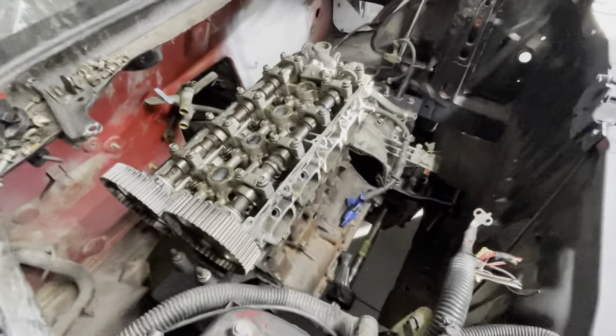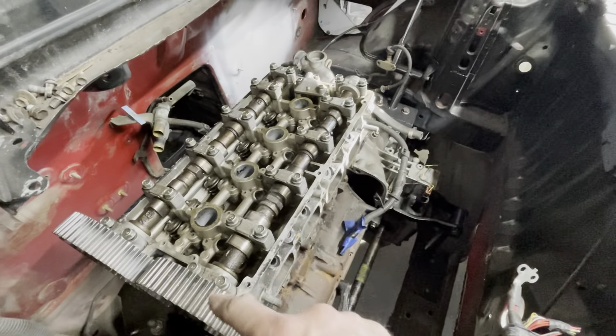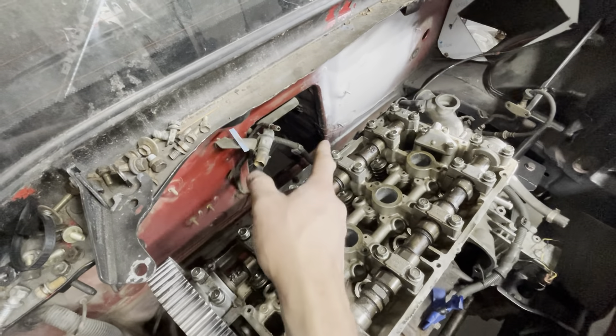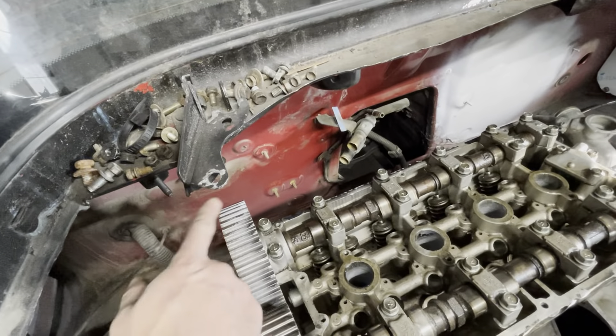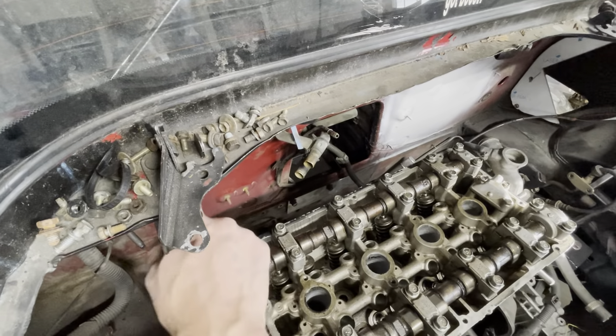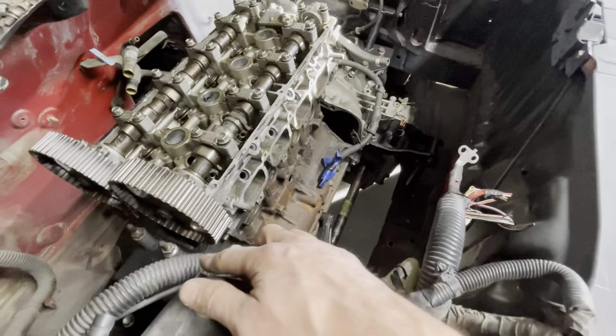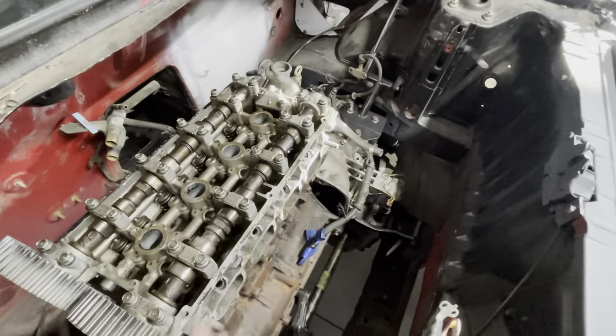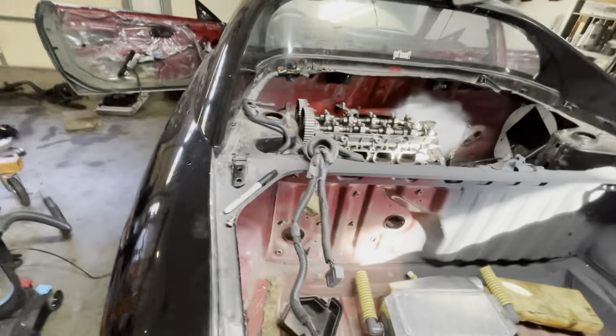It's Black Friday for me, not sure about you guys. Working on the 4G swapped MR2 today. As a quick recap from the last video: it's solidly mounted on both sides with a nice rear roll stop. We removed the stock fuel tank, the filler neck was in the way to make room for the exhaust manifold, and the heater core lines are going to go over the wrapped exhaust manifold and around to where they connect to the 4G.